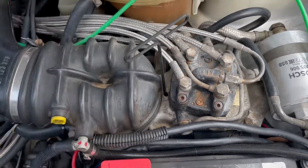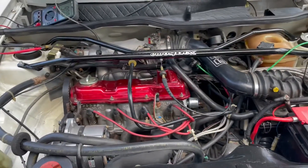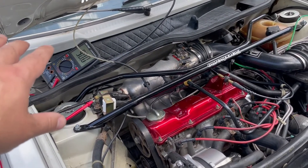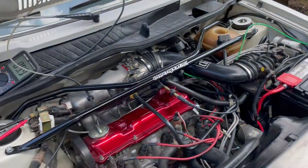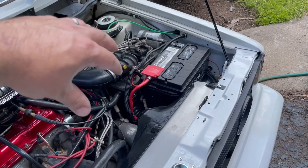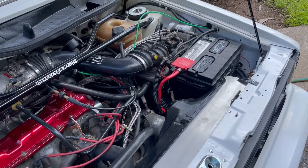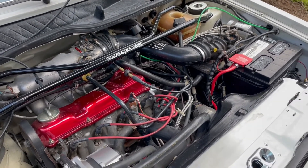You'll feel it go right into the adjusting screw in there. This car is warmed up — you want to do this test with the vehicle warm. Once it starts, you're going to see the numbers on the dwell meter go all over the place, but they should be close to 45. Very slowly make adjustments using that screw: tighten it one direction and the numbers will increase; go the other direction and they'll decrease. Get your base reading, determine which direction moves the numbers down toward 45, make your adjustment, let it stabilize, and that's the process.